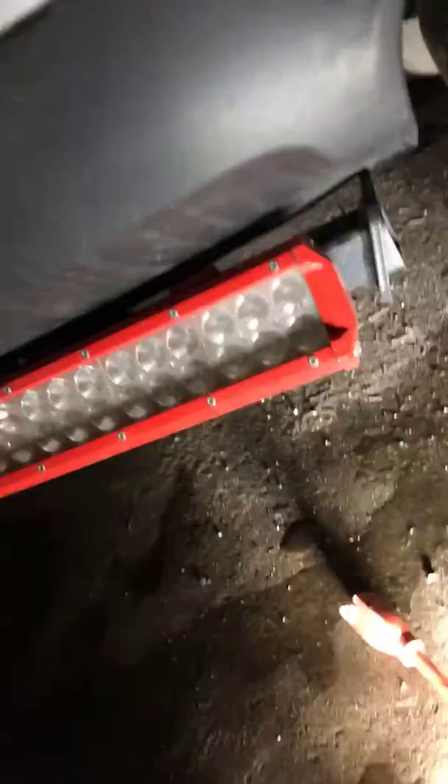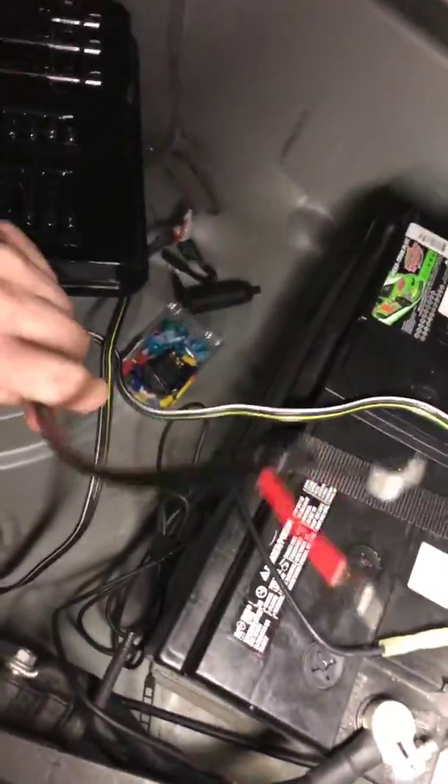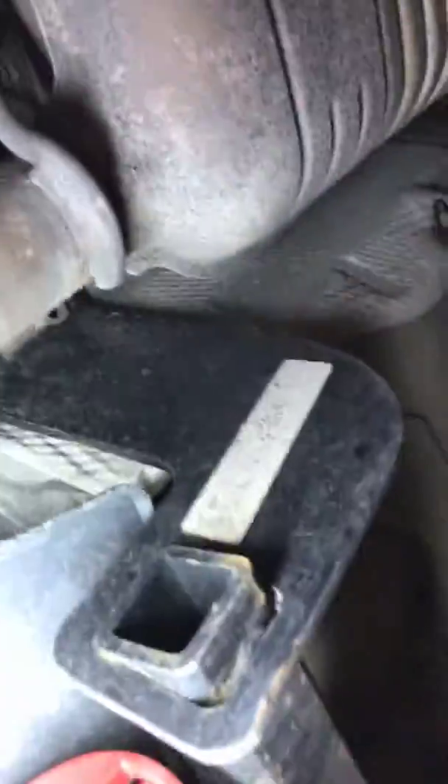Hopefully this will help people deciding to do trailer hitches. The actual trailer hitch mounting itself isn't too complicated. I mounted an LED bar and ran the power cords through the bottom of these little cups right here, then you just have your power and ground and a switch toggle — I just buy a switch off eBay. The trailer hitches are really easy to mount, basically one or two bolts down there and a bolt that goes through the frame on each side. You do need a T10 bit to drop the exhaust system so you can get it mounted properly.